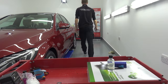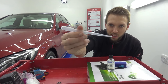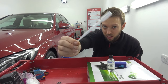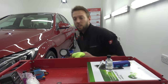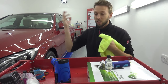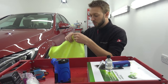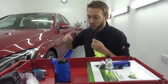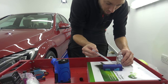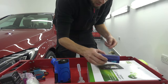You apply the topcoat using one of these foam blocks wrapped in a suede pad. I get the product out with one of these little dippers — I've accidentally bought about 10,000 of them, so if anyone needs some let me know. You'll also need brand new clean cloths and a light so you can see what you're doing. I've got a lot of light in the unit, but it's handy to be able to move it around to exactly where you need it to see that you've got all the Crystal Serum off. Take the tags off the cloths because they can scratch your car.